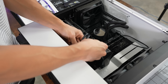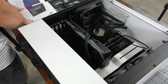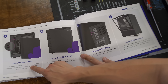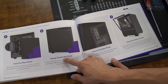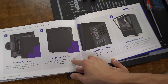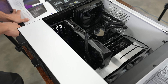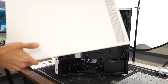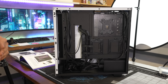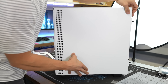Finishing touches: hook the rear panel by latching the two hooks on the corresponding holes on the PC, then swing the panel closed making sure no wires get pinched. Secure it with thumb screws, then close the glass panel. Also, the guide didn't specify to remove the protective plastic peel on the AIO pump block, which I'm taking off now. Right side panel — the cable management came together pretty nicely without too much effort. The PSU shroud definitely helps.